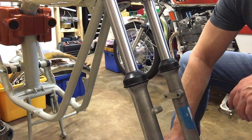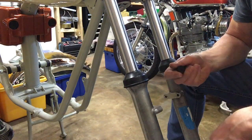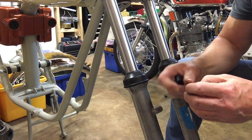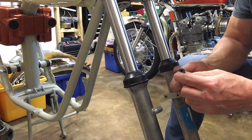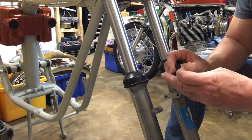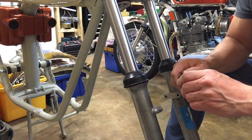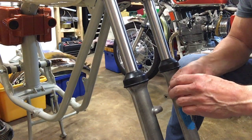Okay, that only took a minute. There's 4 rubbers, if you like, one for each end of each bracket. 3 of these have already been deliberately split, so you can open them out and put them around the wire. One hadn't, but the one that hadn't is actually a slightly different internal diameter to the others, which is annoying and just typical of pattern parts, which sometimes I get infuriated about. I'll come on to that a bit later towards the end of this video, because I'll show you.